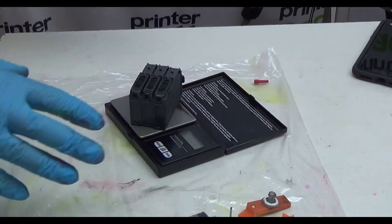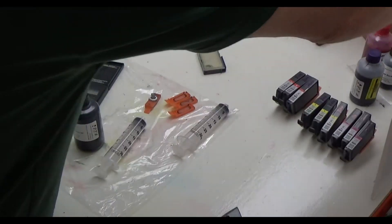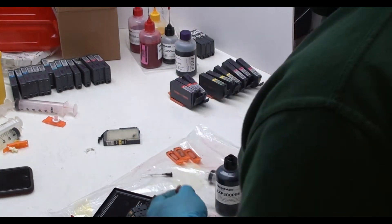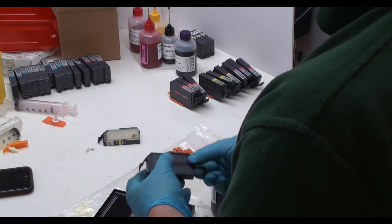Learn from my mistake — I'm a parent, I'm allowed to do this. So there you go, that's how to dig yourself out of that rather big hole. I'm going to now dump this and refill our photo black cartridges with photo black. We already have an ink meniscus on these because we've done all that, so we don't need to do that step. Force filling — attach the flush clip — we've already drawn all the air out because we sucked all the extra ink out.